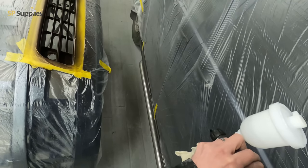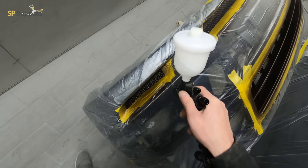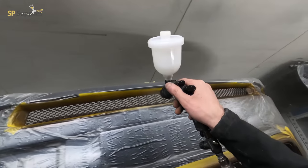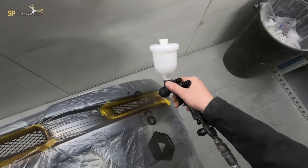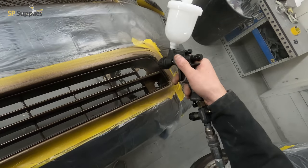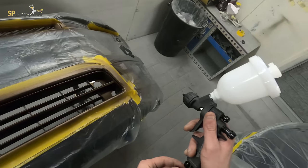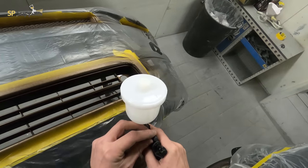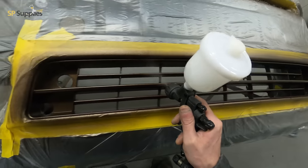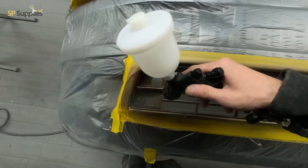I wouldn't say that for most miniguns — usually I try them for a while and end up reverting back to my big guns, turning the fan down, because they feel more comfortable. But with this gun I've gone from painting a large section of a back door to painting intricate grills with no effort whatsoever. The fan size for a minigun is really big. The LPH80 is a cracking minigun, but I found its fan size was too small — if you wanted to do anything bigger you'd struggle; it didn't have enough fan or output for how I personally like to paint.